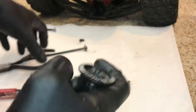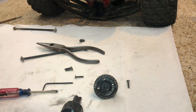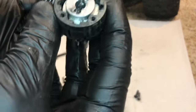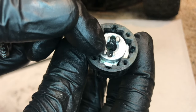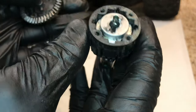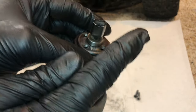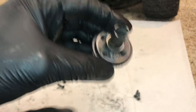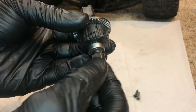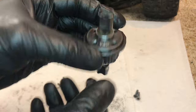This is the thing I'm kind of wondering about - can I get another shim in there? I want these pins pushed as close into that spool as possible so it doesn't round out the spool, which is already beginning to happen on this side. The pin is digging into the metal and pushing up the aluminum. I was able to get two more shims on this side, so hopefully this will tighten it up. Let's get this side set down. I might also take apart the center diff and see if the center diff is an issue, because I'd be surprised if it was just this.